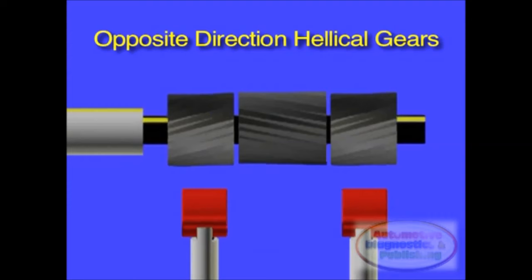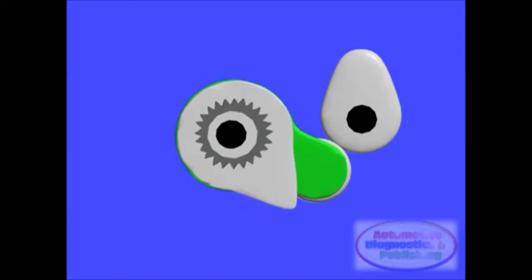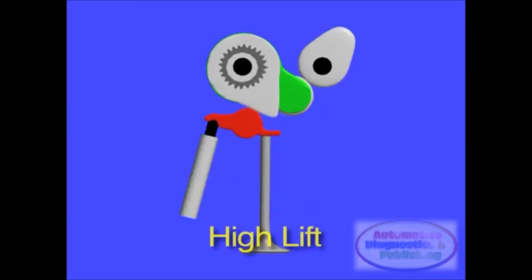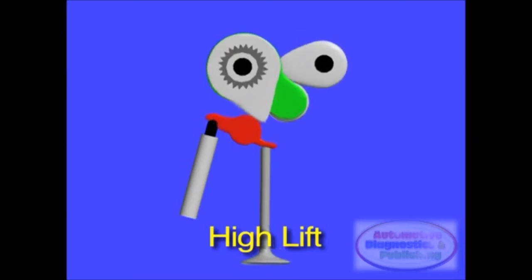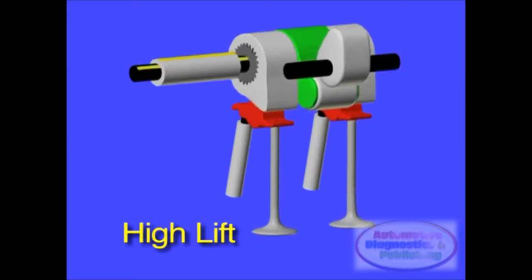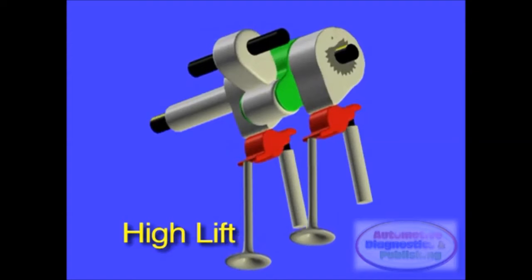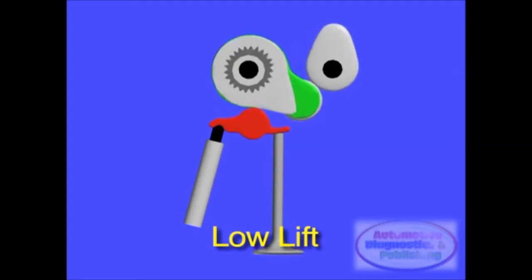This means that when the shaft rotates, the roller member and finger followers will move in opposite directions, moving either apart or closer together. In this way, the angle between them can be varied infinitely by the electric motor. The intake valve is actuated by the camshaft, by way of the intermediate shaft. What we mean is that the camshaft acts on the roller member of the intermediate shaft, transferring the movement to both finger followers, then towards the roller rocker arms, and eventually to the intake valves.